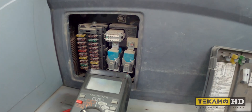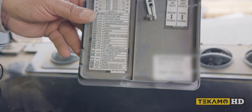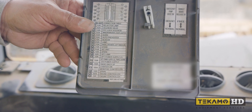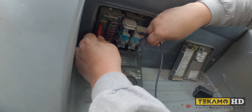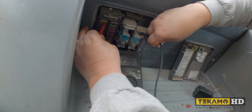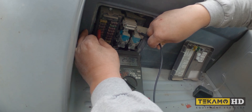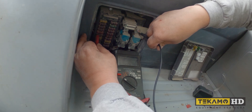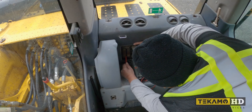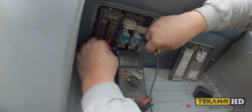There's the fuse panel, and there are the fuses. You can see which fuse goes where. Since we're here, we're going to check them all — if any are burnt out, we'll see which one. We should have 24 or 25 volts — there we go, 25.06 volts on both sides of the fuse. You always want to make sure you have power on both sides of the fuse, not just one side. All of them seem to have 25 volts coming to them. We're going to identify the heater fuse and pull it out to have a look at it and check the spade connectors, especially since the system is open. The AC unit fuse is number 11, a 20 amp — we're going to pull it and have a look.